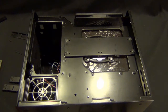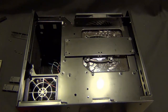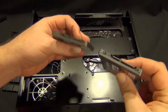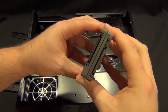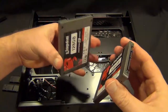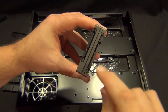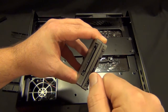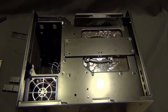One thing to mention about installing the drives: you should have got a supplemental instruction with this case. The two SSDs actually need to be together in this direction so that you have room between the two drives. They have to go face to face — also opposing — so that there's a SATA here and a SATA there, so that the cables don't conflict with each other when you go to plug everything in. I'm going to go ahead and do that off camera real quick and I'll be back with an assembled piece.